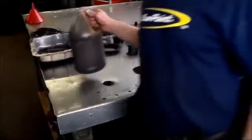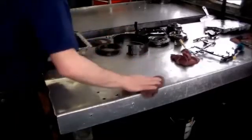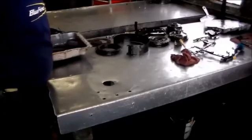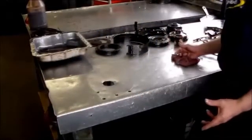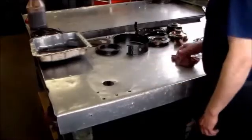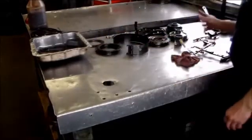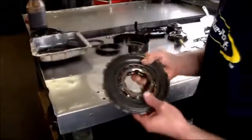So I just wanted to shoot this video and show you these bad parts, just to stress the importance of tire size when you have an all-wheel drive vehicle. I have customers with other all-wheel drive vehicles — whether it be a Durango or whatever. When they come in for regular servicing, every other oil change the tires get rotated so they wear evenly. That way, when the person is ready for tires, they do all four at the same time to be on the safe side. In my opinion, I would diagnose this as wrong tire size.